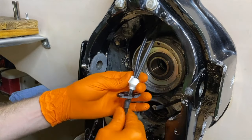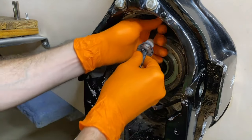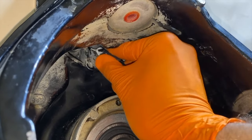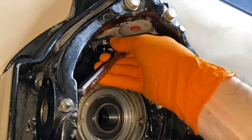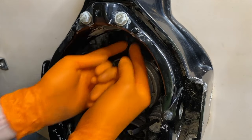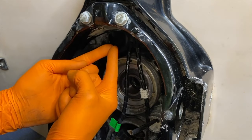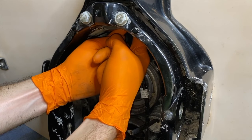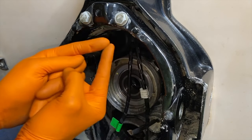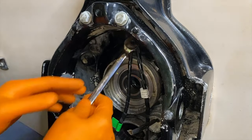To the back of the boat — an annoying and tricky part. We have to feed that wiring up to that hole, properly center the two halves together, and secure the plate with those two bolts. Be patient and careful. As I shift those two halves up into that hole I want to make sure they are aligned properly — I'll secure the lower bolt first. The top bolt I got in by pinching it with two fingers, shifting it up into place, and using the back of my fingers to push the cover plate inward to get it close to the threaded hole, then feeling around until it fell into place — then carefully threading it clockwise. Back to my 7/16-inch wrench.